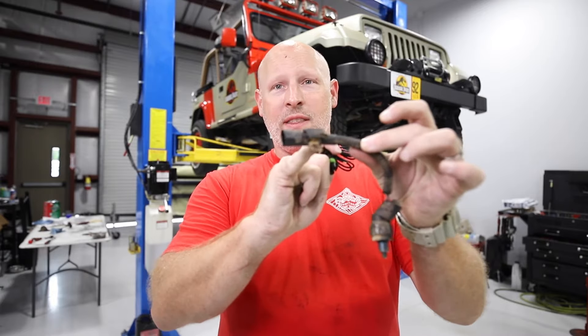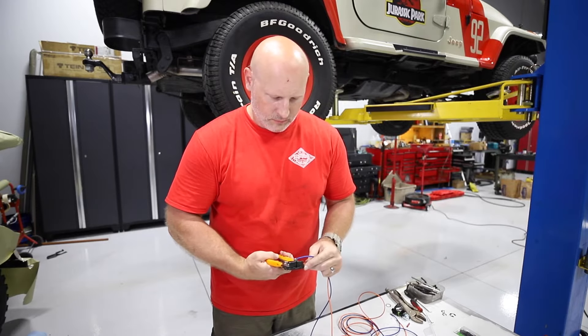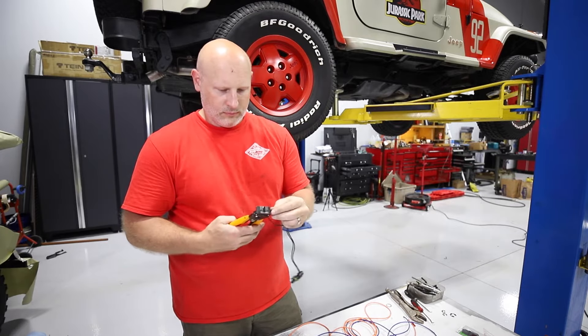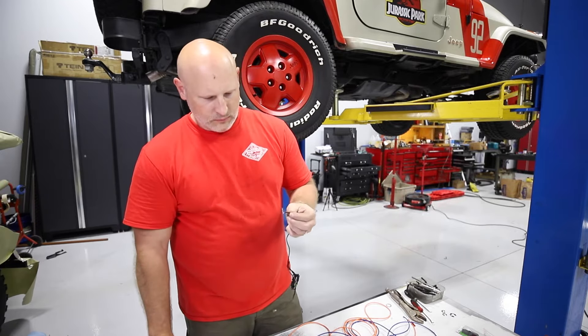Now that we've got the CADVAC delete done, the next step is running the wires in order to use the transfer case to actually engage the four-wheel drive light on the dash. That indicator light no longer works with the current setup, so we're going to extend the cables all the way out to the transfer case, allowing the indicator light on the dash to come on when it senses the transfer case is in four-wheel drive. First, roughly measure how much wire you'll need — it's better to go long at first because we'll be trimming it down at the end. Strip the ends off the wire and get them ready to be connected to the new plug. What we are essentially doing is wiring this up the way a TJ would be, with a TJ plug and a TJ transfer case sensor — links for both are in the description below.